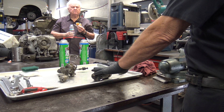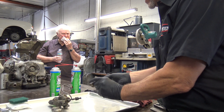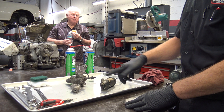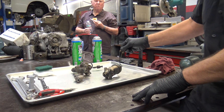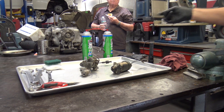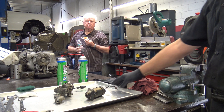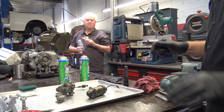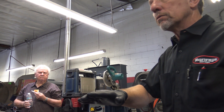The slow action mode is just static. It has three lines going to it: you've got your high pressure in and then it goes through two different ports into the system. Once this is activated with the electrics, it goes into fast action so that — it's designed so when the car is in neutral or park or the doors open and people are getting in — if the car is running, it makes the car level right away.